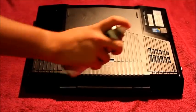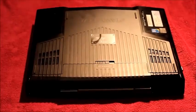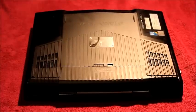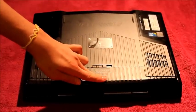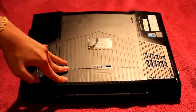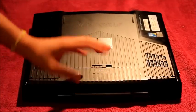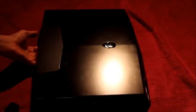And that's that. If there's any dust left on the surface of the vent, you can remove that. You should see it running a lot quieter — the main thing you'll notice — because the fans won't be working so hard to keep it cool. If you're still experiencing high temperatures, you can raise the back. Depending on which battery you have — this is the smaller 6-cell battery — if you have the 9-cell version, it's a bigger lump and won't be flush, which will prop it up and allow better airflow. If you have the 6-cell battery, just putting a book or something behind the back, slightly raising it up, will allow more air to flow underneath and reduce your temperatures a little bit more.